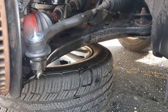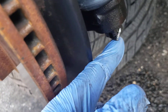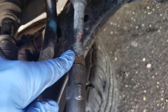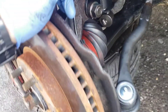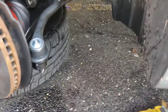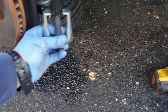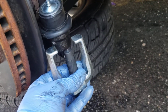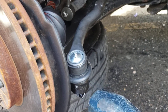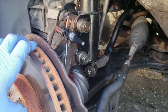And that's pretty much it, guys - tie rod is done. Remember, it's just the nut down here, this nut right here with the cotter pin, and you loosen this nut here - the tie rod pops right out. And you hit it right here with a hammer, or you can use this tool - put it down here and it pops right out. I hope you guys like this video. God bless, take care guys, thank you.